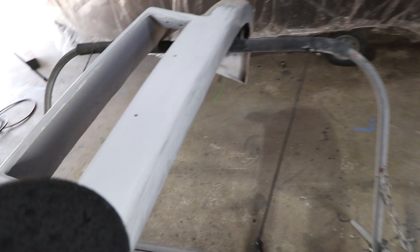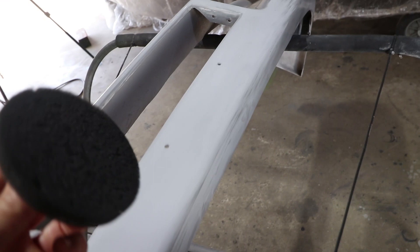Once it's fully cured, I like to just scuff it up a little bit with the gray Scotch-Brite pad. That allows the dry guide coat to sit on the surface and stay on the surface. This is what the guide coat looks like when you apply it — this is the powder type. It just rubs into the primer. This is a good example of what the guide coat does for you — see these darker circles?